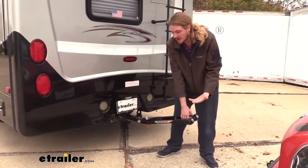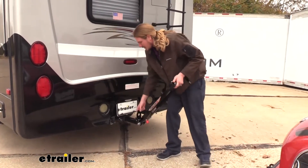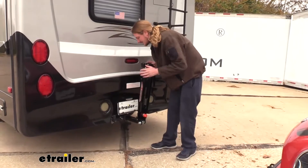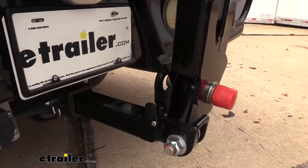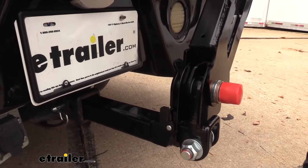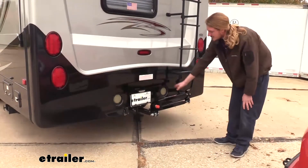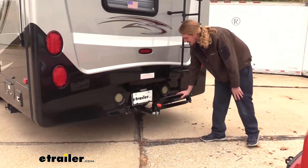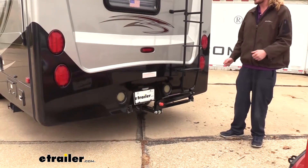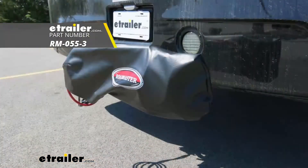When you're not using your tow bar, you can leave it attached to your motorhome. The head of the bolt here, when flipped up, will lock into place — you may have to twist it a little bit to get it to line up. Then push your arms off to one side, whether it be the passenger or driver's side, and you can take off down the road again. If you plan on leaving it on your RV for an extended period of time, I recommend that you put a cover on it to keep everything nice and protected from the elements.